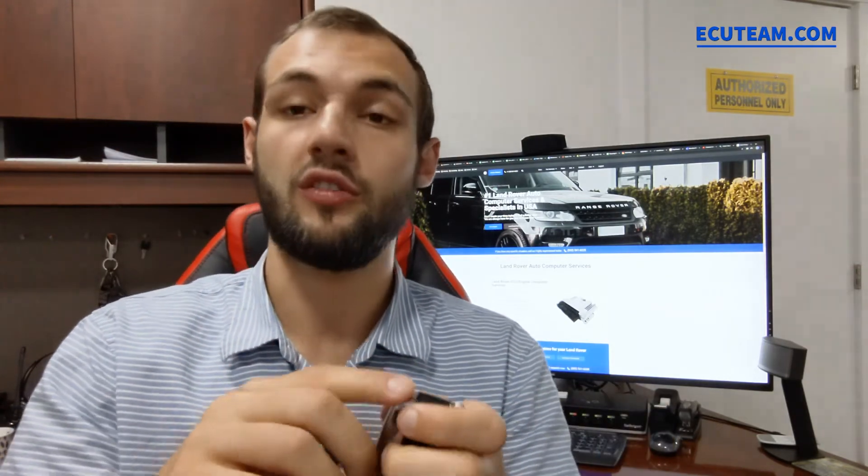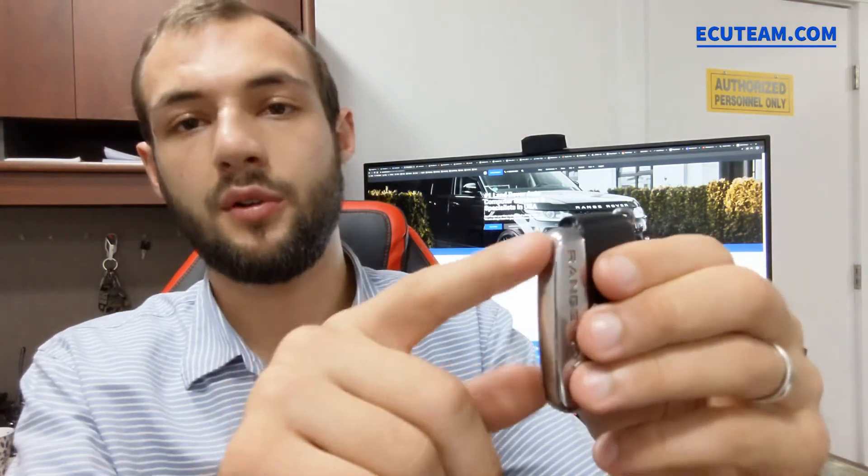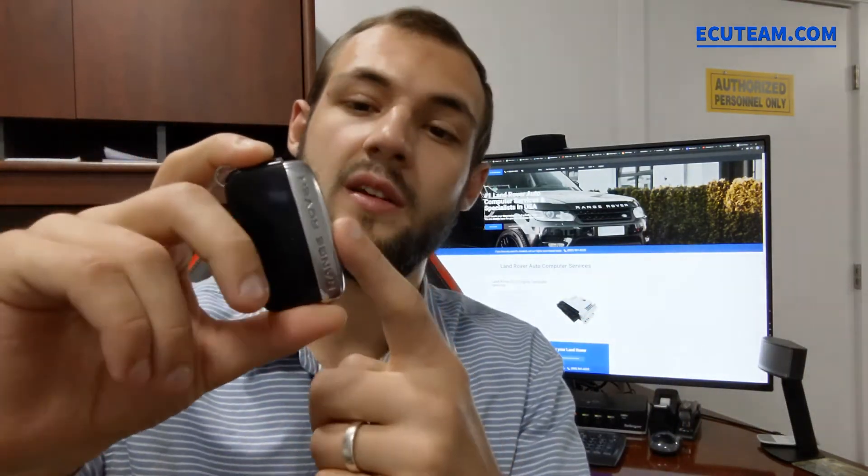We take the last part, which is the metal cover with the Range Rover engraving, and we carefully place this arrow next to the picture on the key. You want to make sure that this arrow goes a little bit higher, because instead of pulling this key down like when we opened it, now we have to pull this key backwards in order to close this panel. So you place the key like this and apply a little bit of force to make sure that this cover closes like that. Boom — the key is closed.